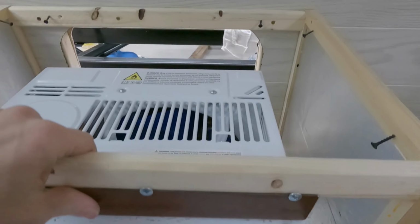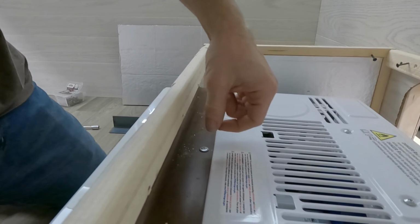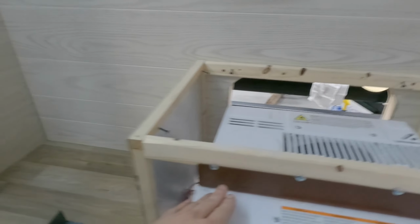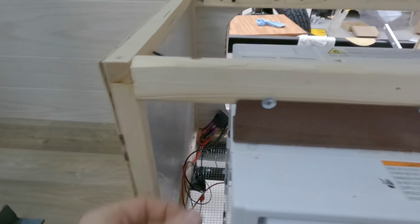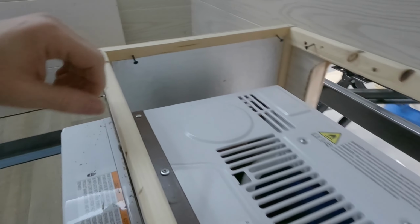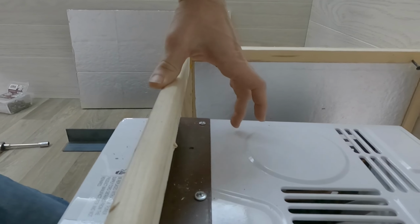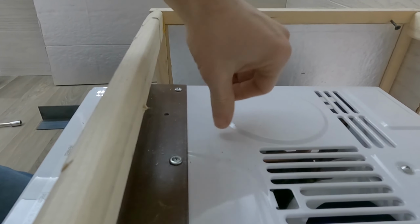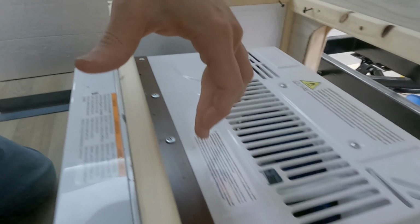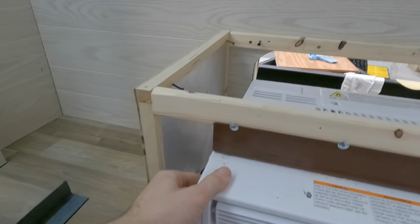So I rigged up this AC unit. It had, from the factory, a little deal that's supposed to come here and stick up to the window, which wasn't in the right spot. So this is just a piece of 2-inch, I don't know what this stuff's called. It's 14 gauge. It's not angle iron. It's like rolled. But I had some scrap of that, so I just rough cut it and estimated. I just kind of set it here and figured where those holes were and punched them, and then drilled those out. Again, there were already self-tapped holes through this sheet metal on this AC unit, so I could use the factory screws that this thing came with for the sides, but these two were a little off, and so I used a pan head just to kind of waller it out a little bit, and it seems stout.